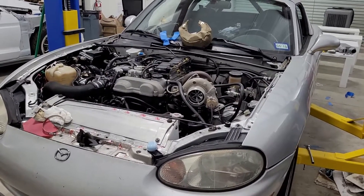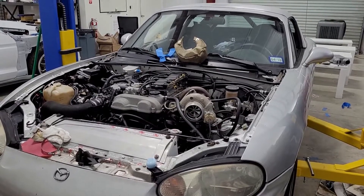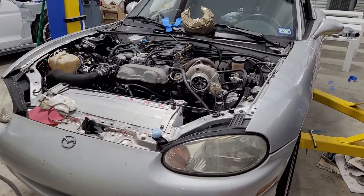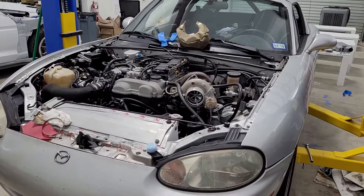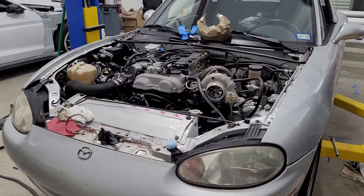That was a big setback back then. Moving forward, I recommend getting a good turbo before going compound, because there actually is one turbo that can do the job. I think compound setups make the most sense in the very high power ranges — when you're looking to run 50 or 60 pounds of boost — that's probably where a compound setup can legitimately beat a single turbo.